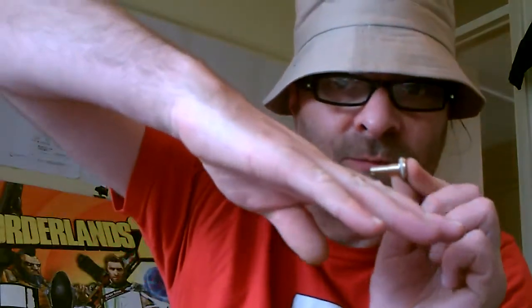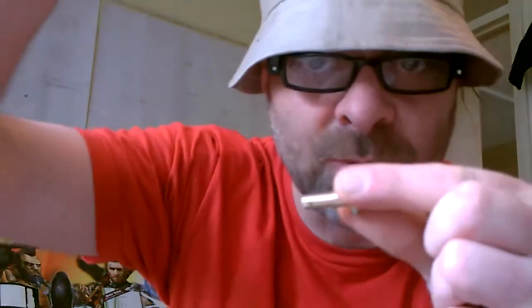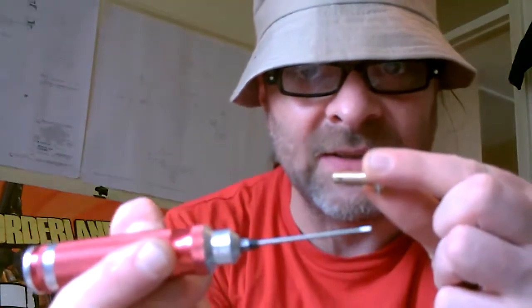Also, your piston. As you can tell, this is massive inside, but it's more to do with the shape of the ports. The actual ports are pointing in the direction that I want the air to travel, unlike the standard piston where the air comes in like this and then has to do a right angle and then go up here, that's not good. You'll also find this now in the new Shocker.